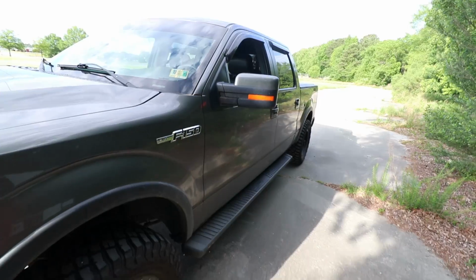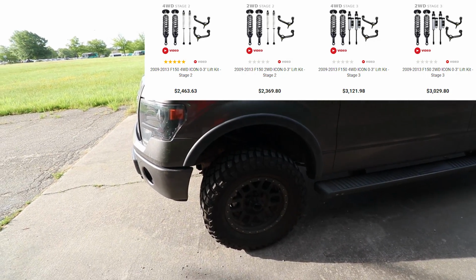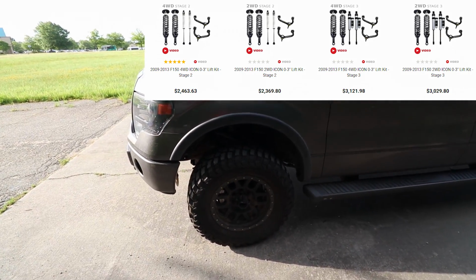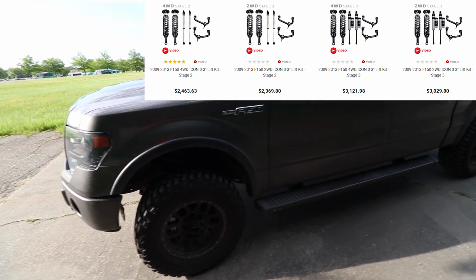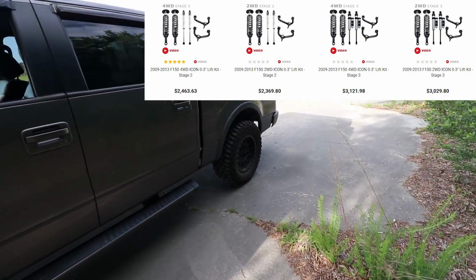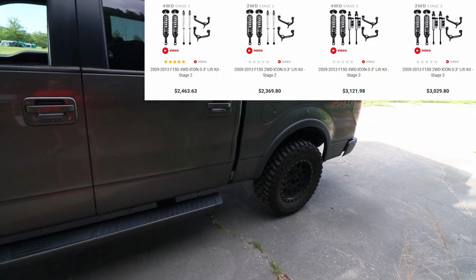off-road performance. So with most lift kits, you'll see different options for maybe some different spring rates depending on how heavy you want to have your vehicle loaded down. You'll have different shock options depending on, are you trying to do a lot higher speed stuff, or do you want to do more rock crawling or just very light trails.